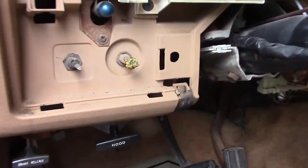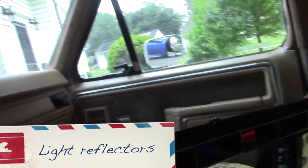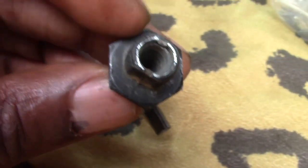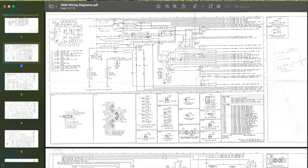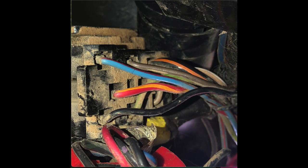It has its own independent power because all the lights are on — I have to figure that out. I used a 17-millimeter socket with WD-40, pressed it up close, screwed to the left and it came out. I couldn't find the wiring schematics for my particular truck — a 1985 Ford Bronco XLT — so I went to garagemahal.com and downloaded Ford wiring diagrams for 1980–1986 light trucks. I went to connector 701, headlamp switch, and determined it was the brown wire connected to the headlamps.